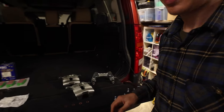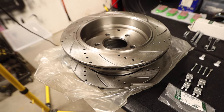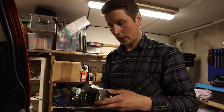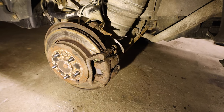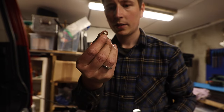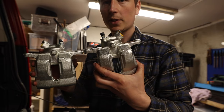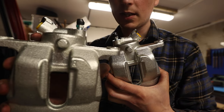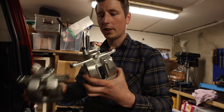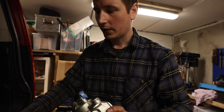Now it's the caliper. I went for Bearmark calipers this time - I haven't used them before so I'm eager to test them out, since I'm using the Bearmark discs as well. The original calipers have been on there since new, so this is the first time it's getting new calipers at the rear. In the package you get the caliper and two cover trims which act as a seal when you screw in the connection. The brackets look the same but they are marked left and right - they're two different ones for each side.